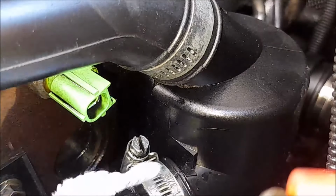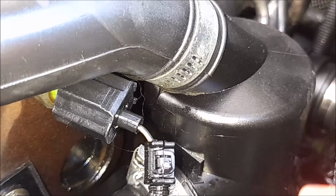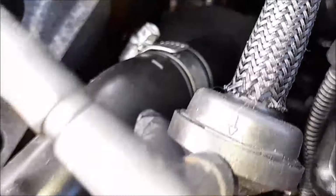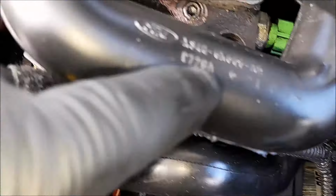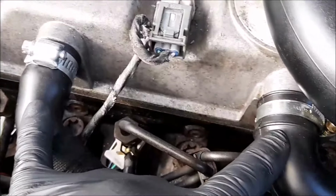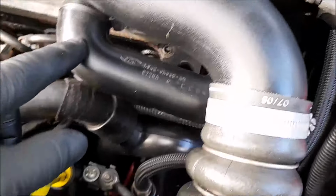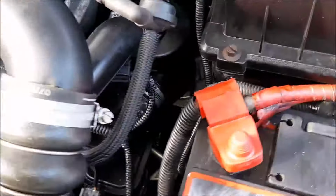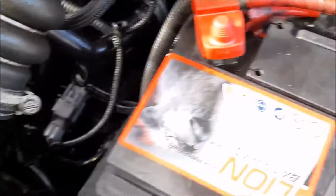You can see it there inside. It's sodden, caked. Right, now to get to this properly, you can just about see it in there, so I am going to remove this hose. It's just two Jubilee clips and it goes around there and around there, and it's one of the vents to go into the rocker cover. Okie dokie. Right, let me crack on and do that, and then we'll bring you in again and we'll undo that together and pop in the new one.